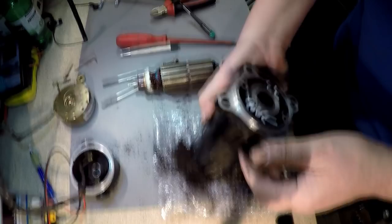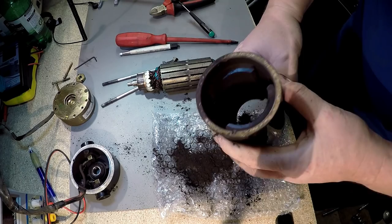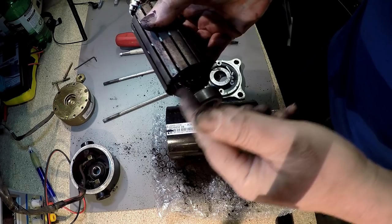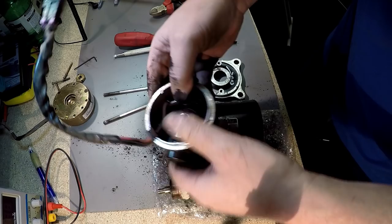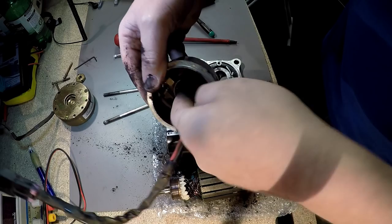As you can see there's tons — there's a base plate away now as well. That's the base plate. You've got quite a few pieces — that's the bottom bit, that's where that plugs in with the bearing. When I'm spinning the bearing itself, it's not as smooth as it's supposed to be, and that's most likely what's causing the slight movement of the motor, causing the brush unit not to sit 100% exactly in here and it's slightly wearing to the side. The other bearing on the top side of the motor is also not as smooth as it's supposed to be, due to the buildup of carbon going inside the bearings, causing wear and tear over the years.